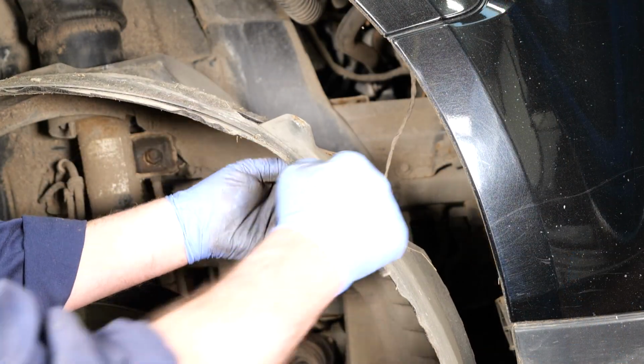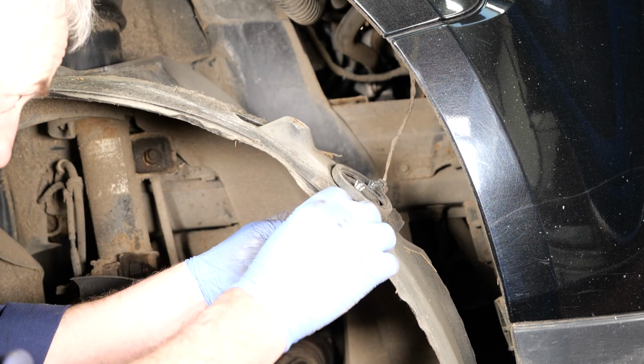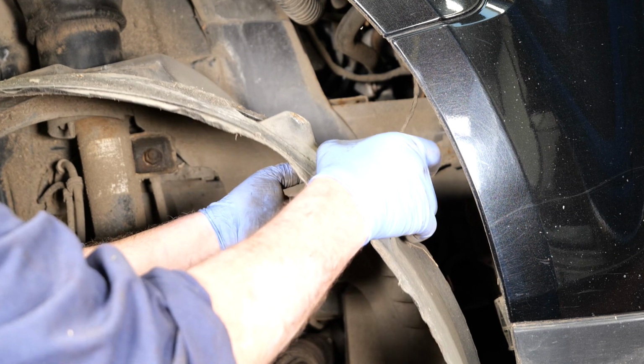Once you've lowered the liner, you can see here there's an item that's bolted through to the liner, and that is the outside temperature sensor. Same as the other screws, there's a little centre screw. You can undo the centre screw. Once that comes out, you'll pull the little tags out and you can remove that out of the way.